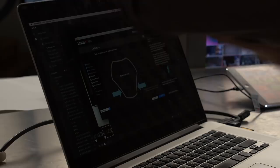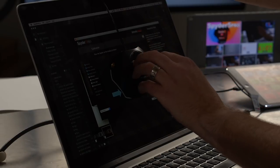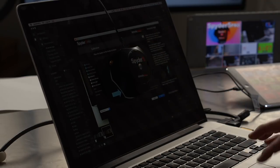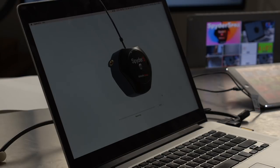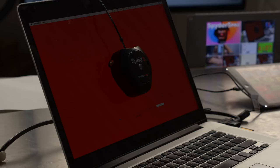Let's go ahead back to this view. You use the cap as a counterweight and place the Spyder on the screen, then click next and it starts running through a calibration cycle. It's going to bring up white, then a bunch of different colors — black, white, RGB, grays — doing a bunch of different tones and basing the calibration off of that. Then it creates a profile and you can name it — whatever you want. It's a good idea to put a date on it, and you can have it remind you every month to recalibrate. Once a month it pops up and says hey, it's time to recalibrate.